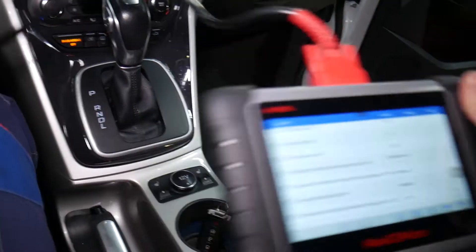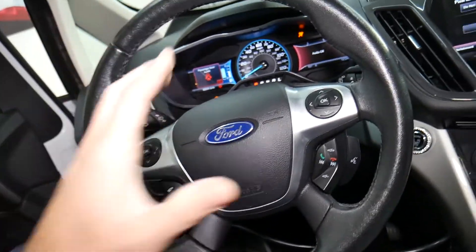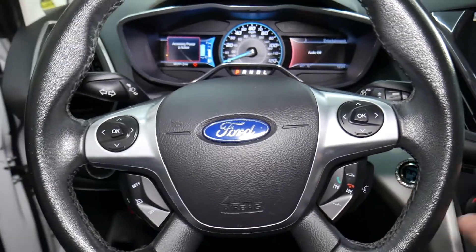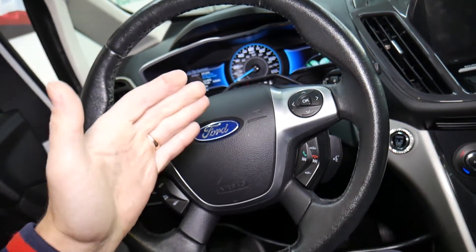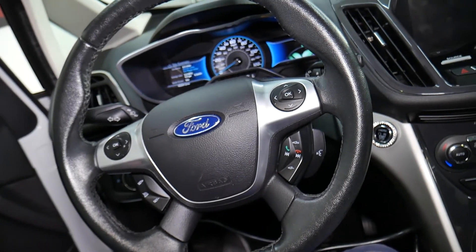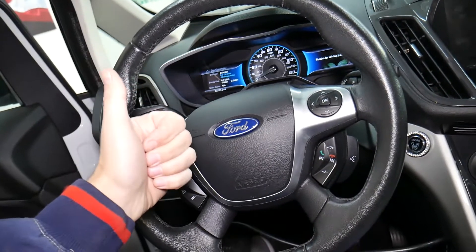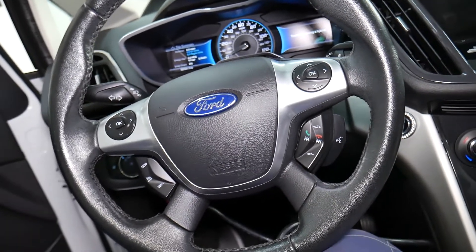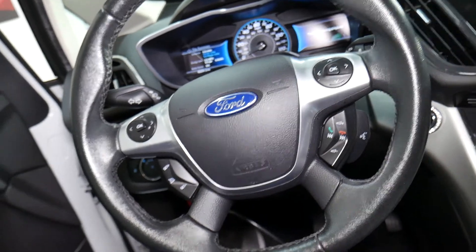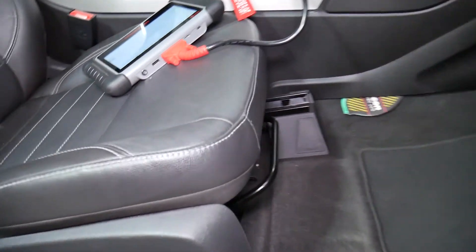Every time you work on airbags, you have to be qualified and certified. Disconnect the car battery for at least one hour before you continue, because that way you can minimize the chance of something blowing up — though it still could happen. On modern cars, it really matters which battery terminal you disconnect and reconnect first. We'll put a link in the description explaining all that. We'll disconnect the car battery and continue.